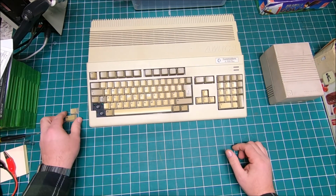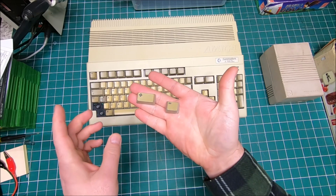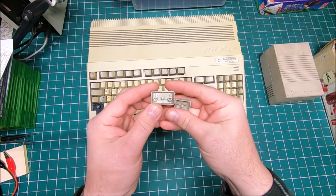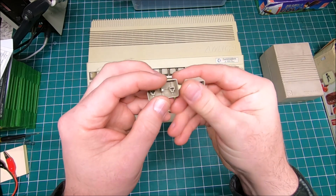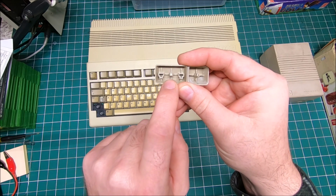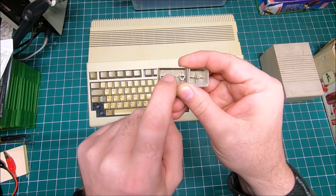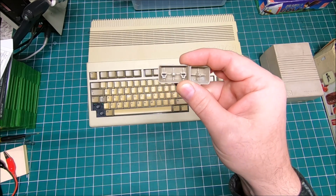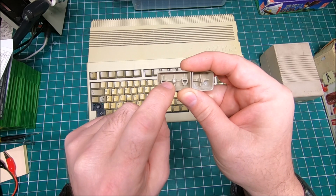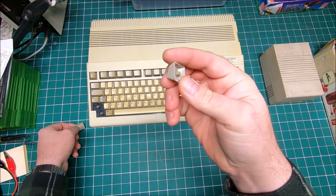Also those two broken keys, the ones I showed in my previous video. Pretty much I did some restoration on both of them. The center studs had been busted, and basically I repaired them, and I also did kind of like a root canal. I installed a brass stud right in the center, and now it's much stronger than it's ever been on both keys.